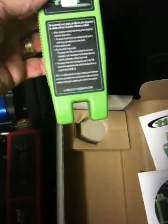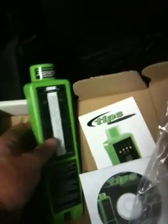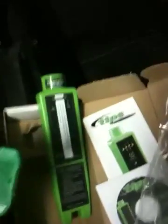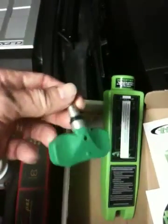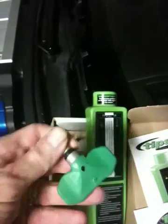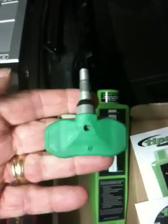This U-shaped area on the bottom is a strong magnet so you can trigger C5 sensors or any others that might require a magnet to trigger them. But most all the sensors in the C6's require a radio transmission from the antenna of the tool to trigger the sensor to get it to send out its data to the TPMS computer so it can be logged into the memory.